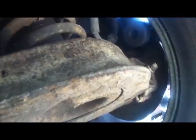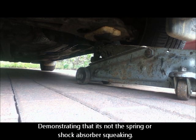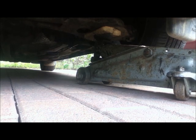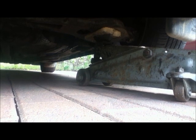The other thing I know is that if you put the jack underneath the spring plate and lift the wheel off the ground it will not make the noise, so it's not the spring and it's not the shock absorber. If I jack the car up under the spring plate and then bounce it up and down with the wheel off the ground, I don't get that really loud noise.